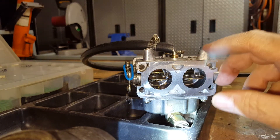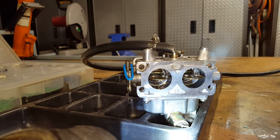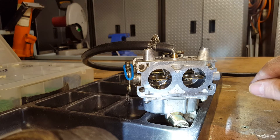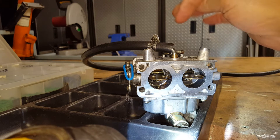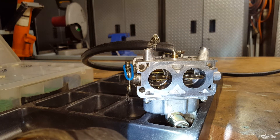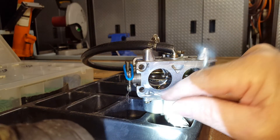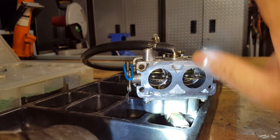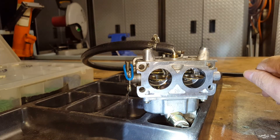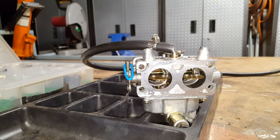Basically the pulse pump puts out about 1 to 1.5 psi, so theoretically this pump should be too much for how it was designed. I've seen gas come back out that way just on the electric fuel pump with it static, so at this point weeping on one side — this is not conclusive. I'll rip it apart and see what we get. Okay, it's a start. See you guys later, bye bye.